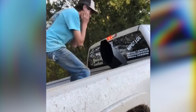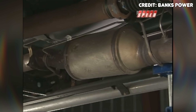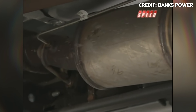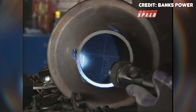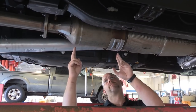But you have to remember that modern diesel trucks have emission systems on them, and those emission systems create heat. More specifically, modern diesel trucks have a diesel particulate filter. The diesel particulate filter, also known as a DPF, isn't what causes those crazy exhaust gas temperatures, but rather how the DPF is cleaned. The job of the DPF is simple: capture excessive exhaust soot and then burn it off occasionally through a regeneration mode.